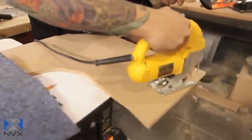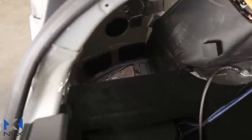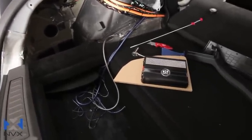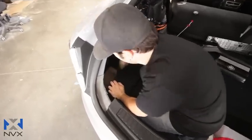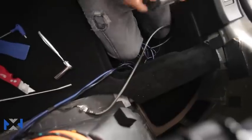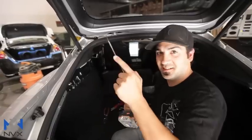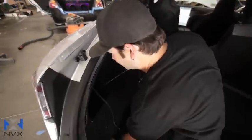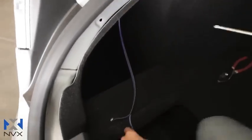What I did here is cut out a piece of insulation underneath the factory carpet in the cubby, traced it on a piece of half-inch MDF. As I said at the beginning, a lot of people do not like to screw their amplifier down into the body, so this MDF piece will fit right back down in there. I recommend attaching the piece of wood with either some double-stick tape, liquid nails, or silicone — let it dry. Once it's dry and nice and secure, you can flop the carpet right back over the wood, and now you have a solid surface to mount your amplifier to, screwing into the wood instead of the body.